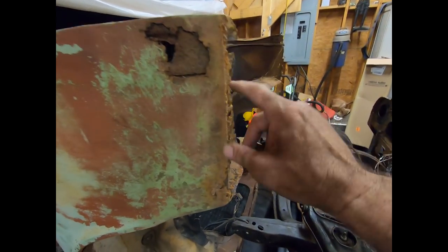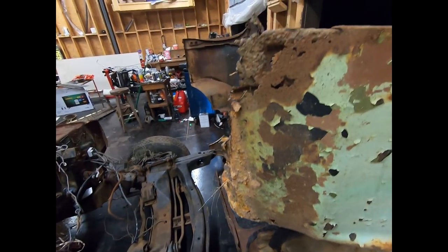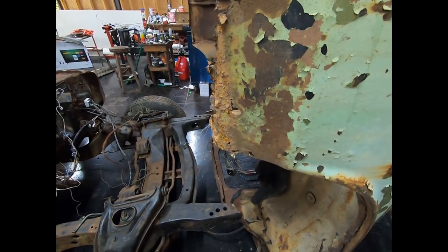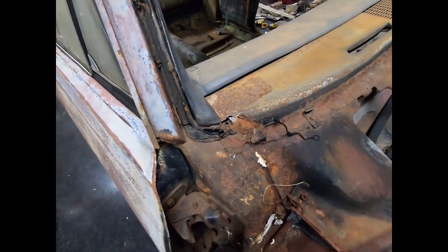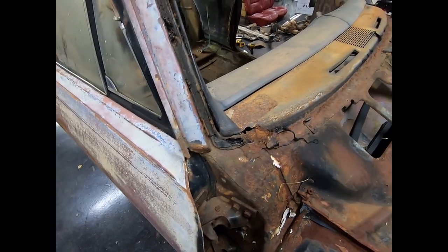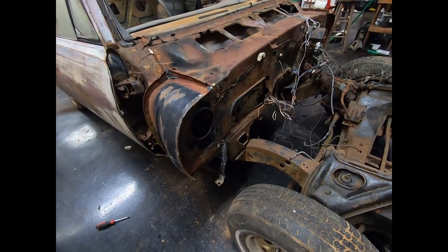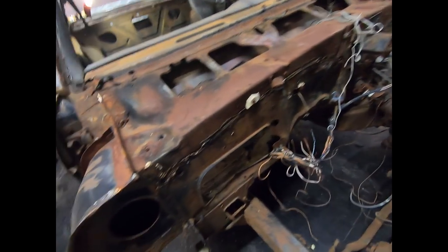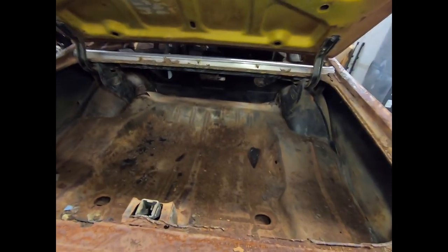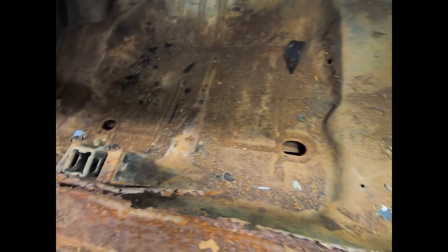The driver's side fender is pretty shot, but I can patch that up — I can either fabricate something or buy a patch. The passenger fender is a lot worse and a lot more of it's missing, so I'll probably have to patch that with a purchased patch. The passenger side upper dash and upper cowl where all that meets is pretty bad, but maybe I can do something without having to buy a replacement dash panel. The cowl panel is okay, not rusted. The seam sealer is shot over there, but that's not too bad. The trunk pan has some pretty good rust holes, but the rest doesn't look too bad — probably a few holes in it but overall usable.